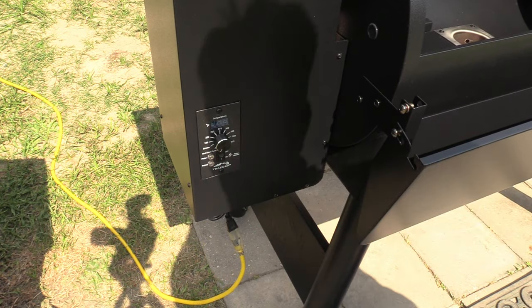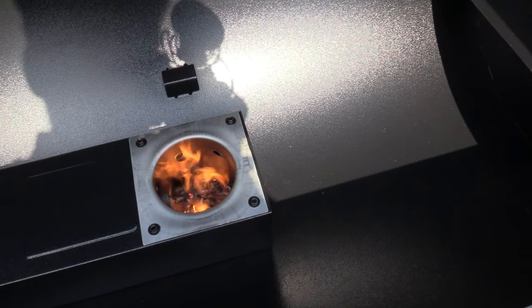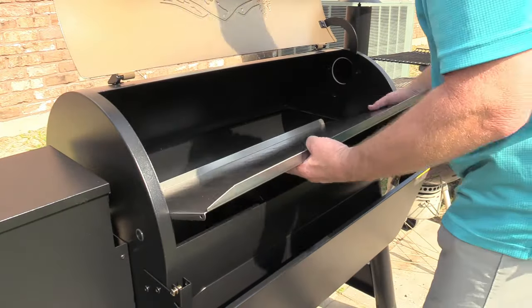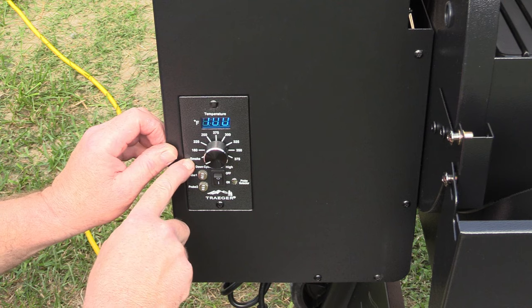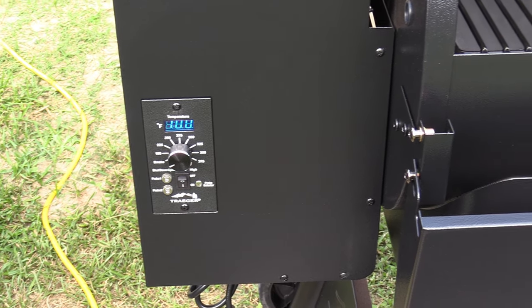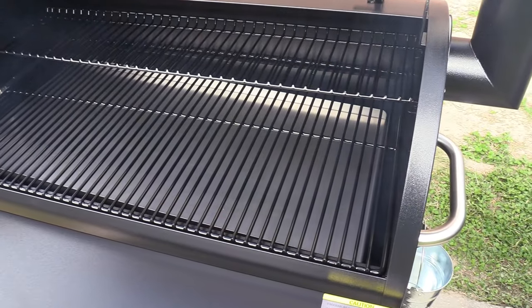Now I'll go back to shutdown and that normally takes about 10 minutes. We're gonna let this burn off and finish burning off the pellets, then we'll put this thing back together and get it burned in. Setting it to smoke with the power on, we're gonna let it get up to temp and burn that sucker in. Usually takes a couple minutes to get going. Once we get a little smoke action, we'll start the burn-in and get the temp up on it.